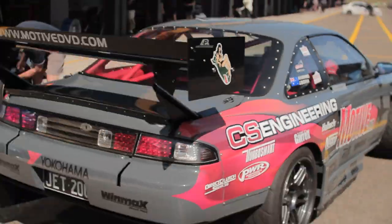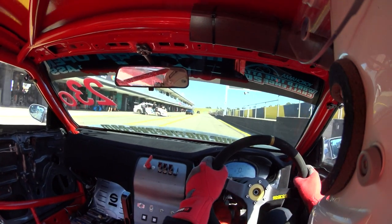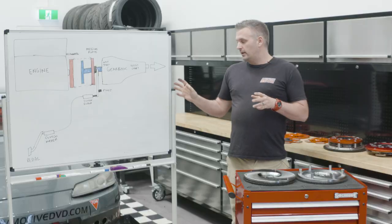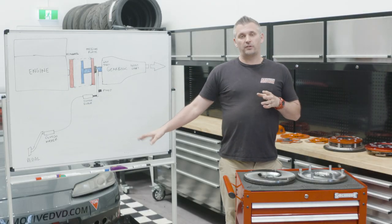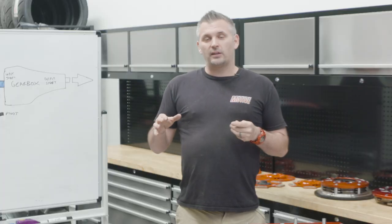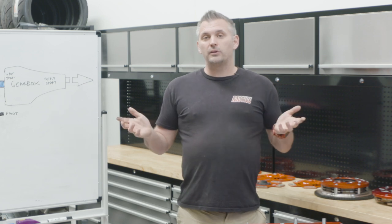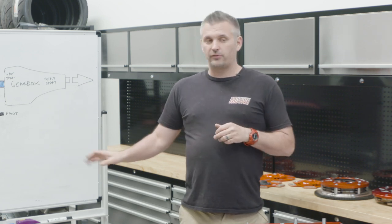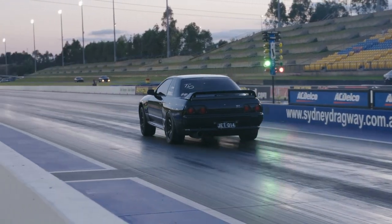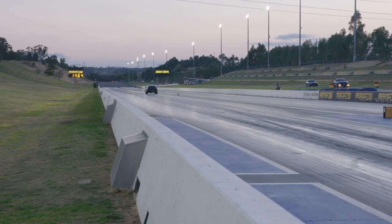That thing is terrible to drive — you can't drive it on the trailer. Combined with a long first gear, it's a pain in the ass to drive around the pits. In fact, I wouldn't wish driving that car on the street to my worst enemy. But it only ever uses the clutch to leave the pits or move out of the garage, and once we're moving, we barely use the clutch due to the dog engagement box. But the GTR gets driven on the street and gets drag raced, so a heavier flywheel actually makes the thing nicer to drive.